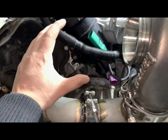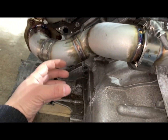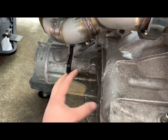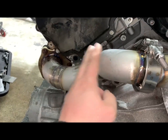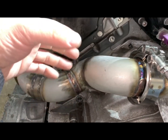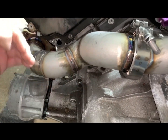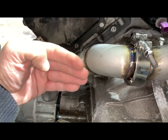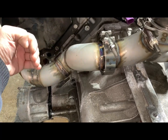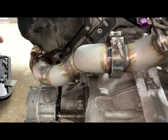The dump pipe is going to go closer to the filter housing. I'll set it down here, braiding down, and put the V-band — the first V-band is going to be right there, somewhere in this area. That's why I did this offset: the offset is for the reason of the dump pipe. I'm trying to be as tight as possible with the dump pipe in here. The firewall starts somewhere around this area, so it's pretty tight.